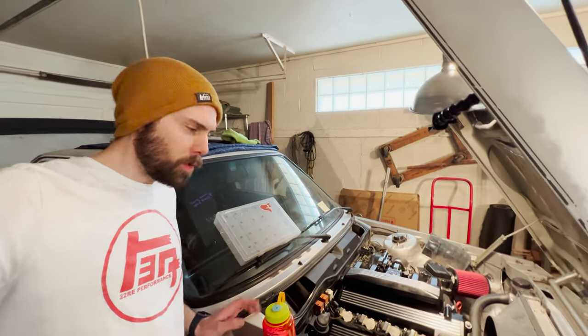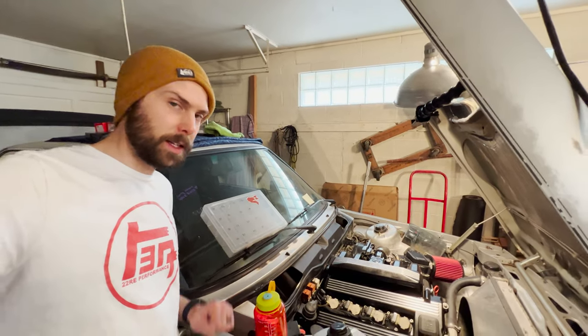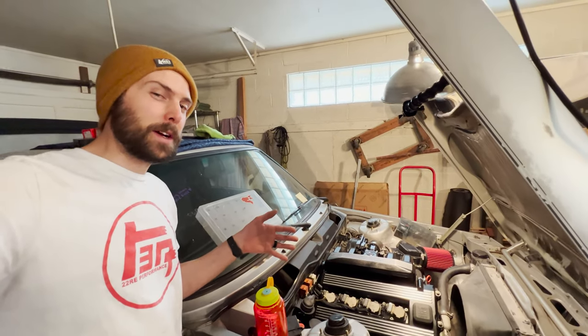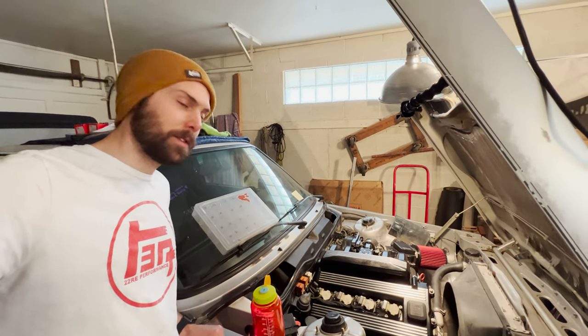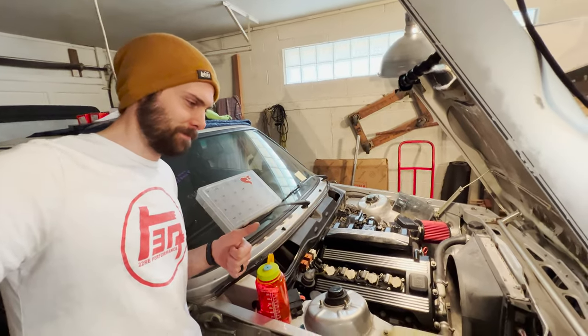So before I change the oil, I'm gonna go ahead and let the existing oil run. And I got some Liqui Moly engine cleaner to run through the oil system. I just kinda wanna make sure that the filter that's in there right now is gonna catch all the junk that may have gotten in there when I was cleaning off the valve cover surface. But other than that, we're ready for a first start. So, yay!